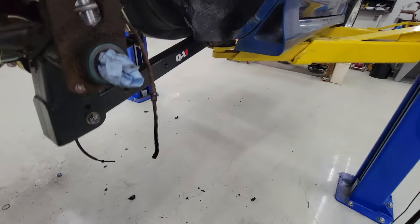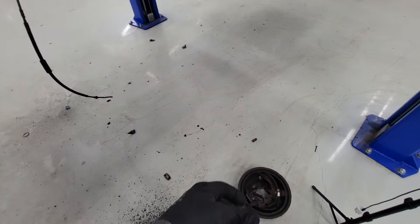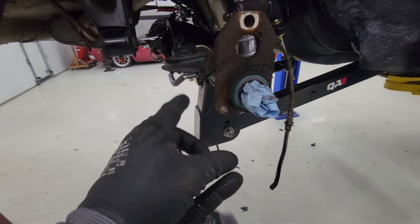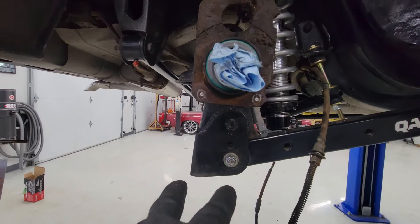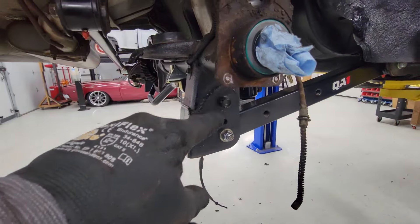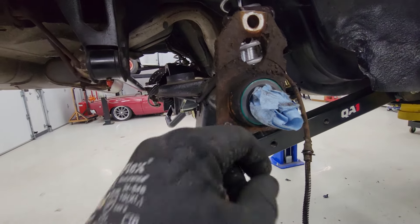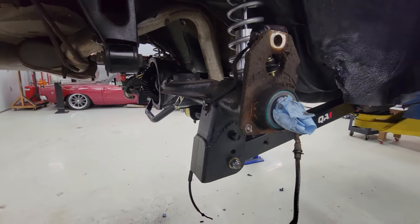It's all off. I did have to get the old Sawzall out and cut the bolt that holds the top of the dust cover on — that stud was not coming off. There's all the garbage we pulled off — all the springs and hardware. I'm four for four snapping bolts; none of them came out. If your car is crusty like mine, just be prepared to Sawzall that bolt off. Drill a pilot through the stud, step it up, and use one of those bolts as your alignment point — get it all centered and you'll be fine.